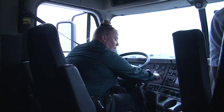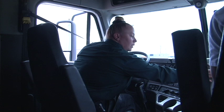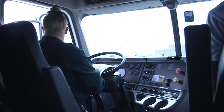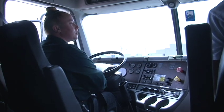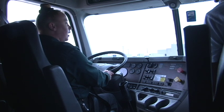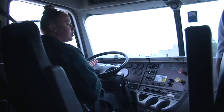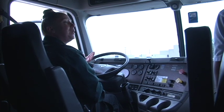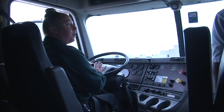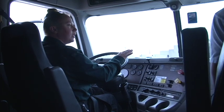Gently apply the service brake — you only need five to ten pounds, that's it. Release the trailer brakes. Remember there's some delay as you release the brakes — wait for all the air sounds to go away. Bring your clutch foot up about halfway, almost even with the brake pedal, and start to feel where the clutch begins to engage. As it begins to engage, pause. Feel how it starts to engage — you can feel the truck move just a little.